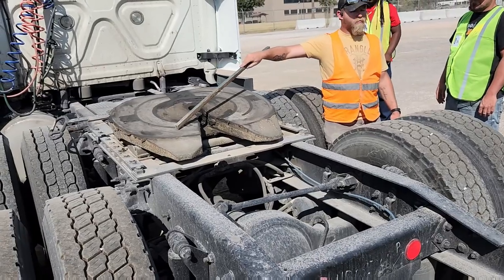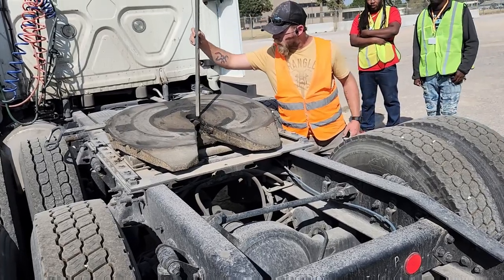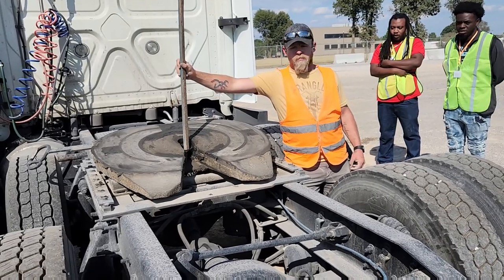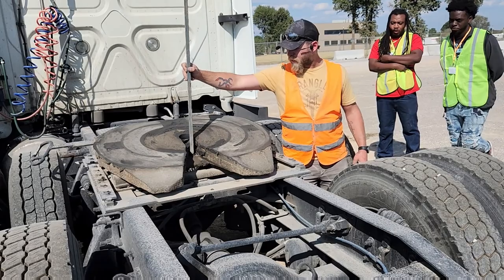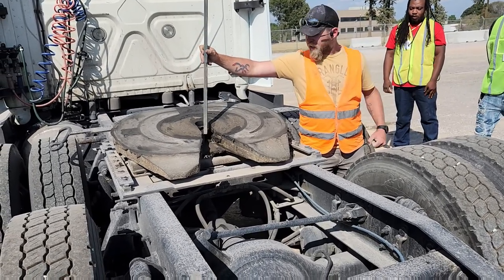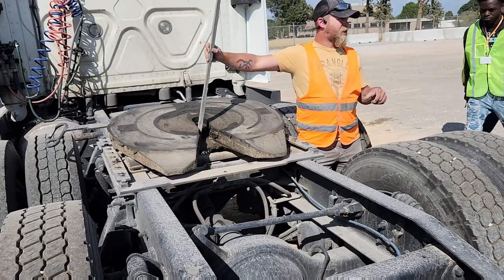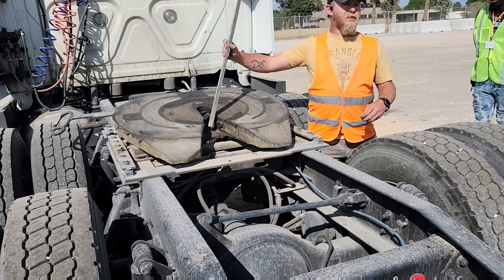Skid plate. Okay? Inside here in the middle, this piece I'm touching right here, that is the jaws. Right behind it is your safety latch. When your kingpin slides in, your jaws will lock around the shank. And when they lock in, this big chunk of steel slides across. It's like 2 inches wide, 1 inch thick, solid steel. You're not gonna tear through that, I promise.